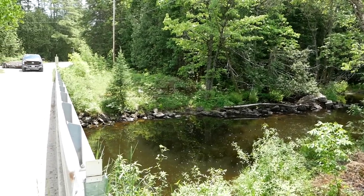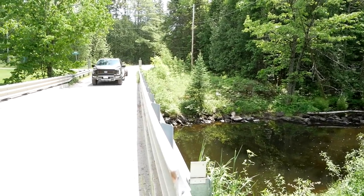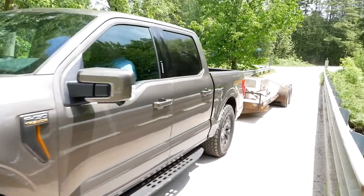The reason we're looking at these things is because if you buy this Tremor, you probably want to do more off-roading than a regular F-150 guy, but you may still be running it for work Monday to Friday — towing your camper, your boat, your power sports stuff. Unlike a Raptor, where you take a real big hit in towing and payload, this doesn't do that. You can get that Torsen limited-slip front diff — which came from the Raptor — and I think Ford's idea was to give you all the Raptor stuff they could without sacrificing towing or payload.